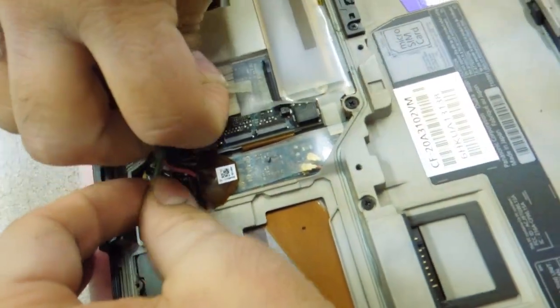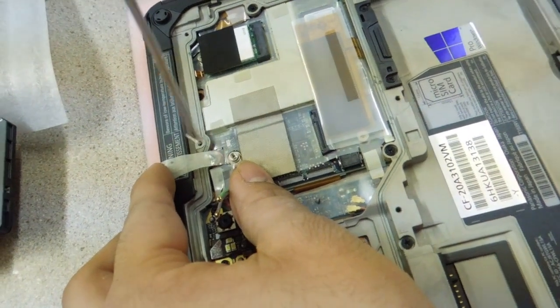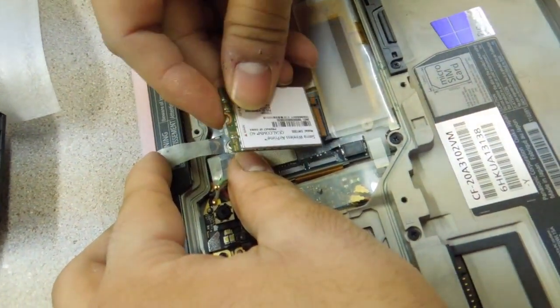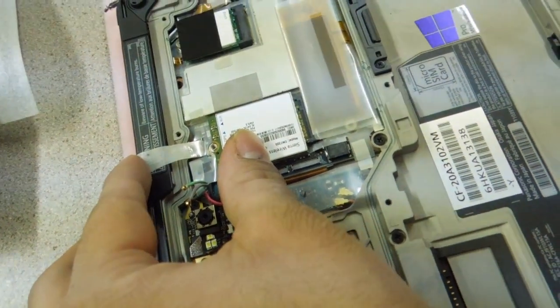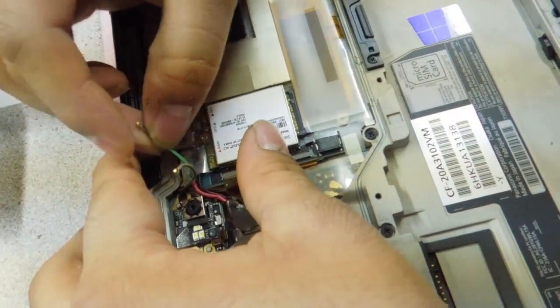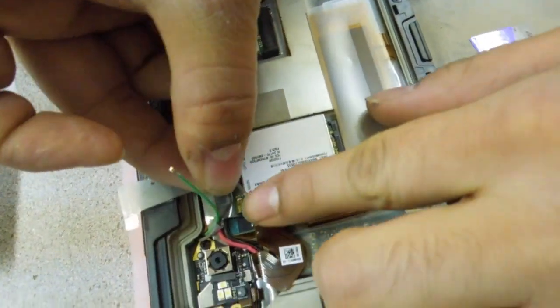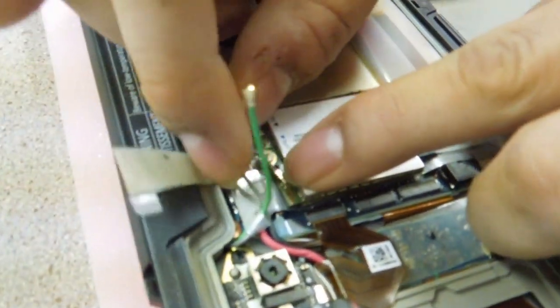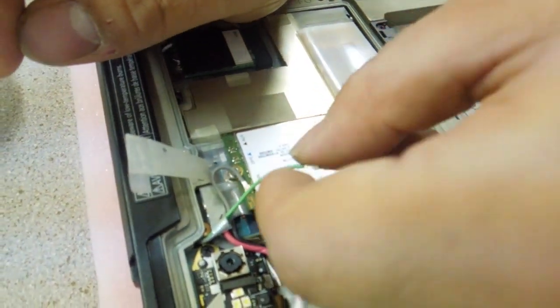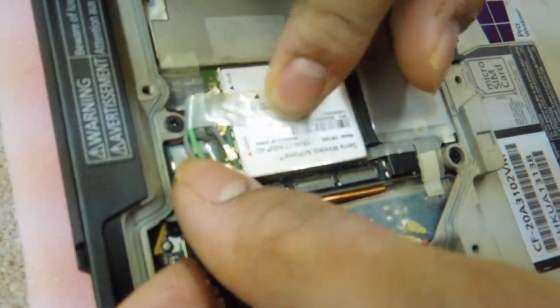Now to the card. Pull up the piece of tape because that will just secure the card down. Take your screwdriver and pull out the single screw. Go ahead and slide your card in — make sure it's nice and snug when you put it in there so it lines up. Screw it in. And the tricky part: getting the cables on. Now normally your neutral tone color — so the gray cable will be your main, which you kind of just have to bend it a little bit. Snap that on there. And then your green one — a lot of the time green is associated with your GPS, but for WAN cards it goes on your auxiliary and not your GPS cable. Once that's on there, just tape that down over the top. Helps keep the cable secure on there, and close it back up.